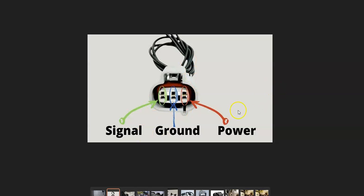If you are getting power, then there's no issue with the fuse. The next thing would be to check the signal wire going back to the computer. There are different ways to do that — you could check continuity, or some techs will take a known good sensor, attach it, put the key in the on position, and go from the ground wire to the signal wire with a multimeter. When they put a piece of metal directly in front of the sensor, they'll get five volts going back to the onboard computer.